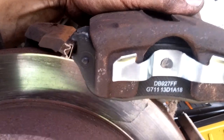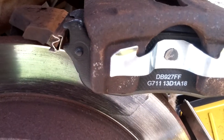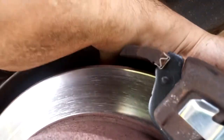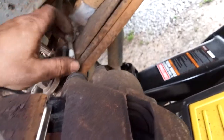When you put the caliper on, there are little grooves in the brake pad — they have to go over the top first and then make their way down to the bottom and hook in right there. Always start them at an angle before you push them over your rotors. As you're sliding it in place, those little slide pins might get in the way, so pull them back as you're pushing this on. Before you know it, those are locked in to the top and slide in on the bottom — so it's ready to put the new sliders right back in.